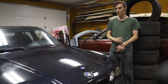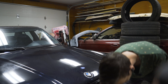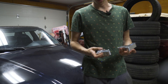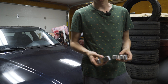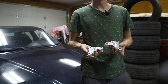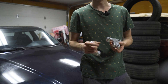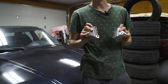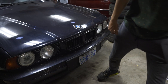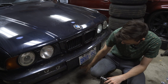Still just kind of working out kinks in the tune. I've got the AKG Motorsports bump steer correction spacers - or plates, or whatever you want to call them. These go between the front lower control arm and the bottom of the strut. I'm going to start by taking the bumper off since it makes it easier to fit the jack.